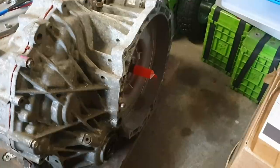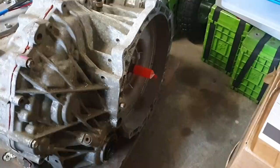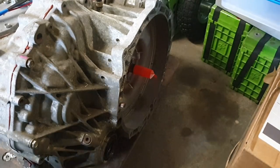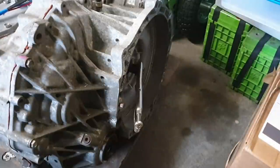The first step is that we ensure that all of the high voltage is completely turned off. So we've got no HV at all, we don't need it. What we do need is access to the motor shaft so that we can manually turn it. Now, although in this transaxle MG2 would normally not be connected to the engine input shaft that you see there, in this case, because we have the welded power split device, it in fact is. So we can simply take my piece of rather tough duct tape off here and just put vice grips on here and just confirm that we can do a full revolution. So that is our first thing that we need to do.